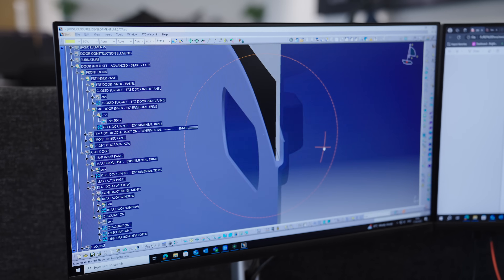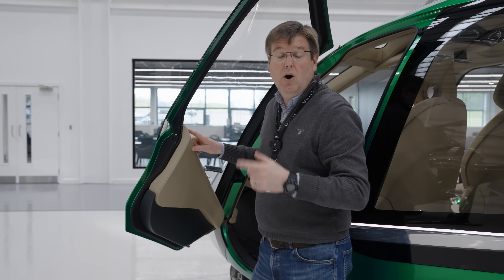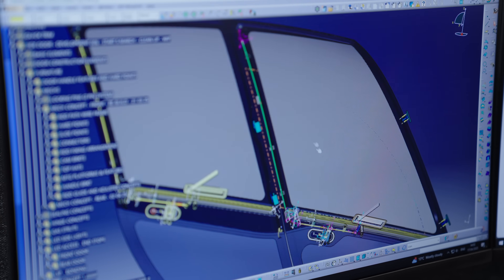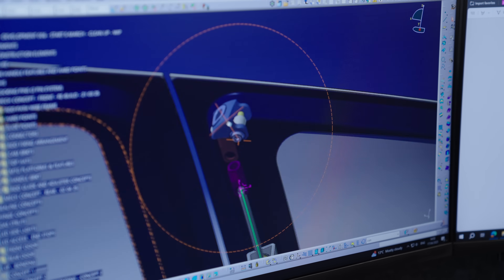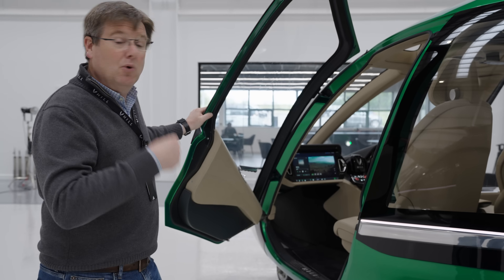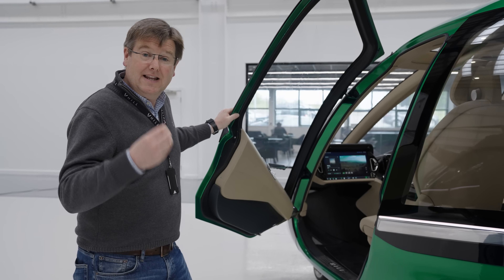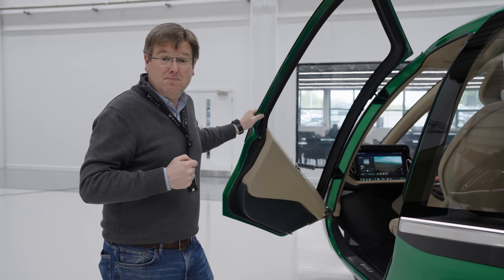That leaves sections within the door hollow, so we've got room to route the push-pull rods that operate the three-point locking mechanism to keep the door sealed robustly against the fuselage. We've also improved the door recesses in the fuselage to allow a bigger and more effective bulb seal to keep wind noise out, the rain out, and to keep the fuselage as leak-tight and aerodynamic as possible.